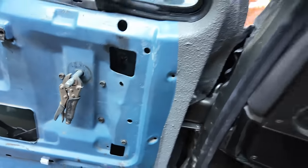I have lots of stuff here. Things I need to do, upgrade the alternator. I need to get a more powerful alternator because when I put the lights on this, it's not charging enough. I'm getting like 12 volts charging. That's not good. When I turn them off, I'm getting like 13. I have a custom fuse panel, like a distribution block, I want to put up under the dash somewhere. I have lights I want to put in here. I also have a USB thing that also reads the battery voltage, so we kind of offset that one. But I want to put that up here where the fuel switch is, because I'm going to do away with this since I'm taking one of the fuel tanks out. There's no sense in having that switch in there because you're just going to turn your fuel off. She runs like a top, boys.